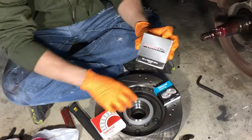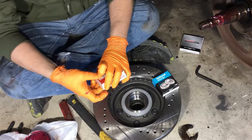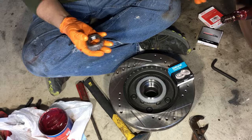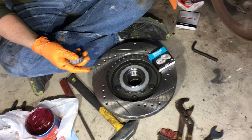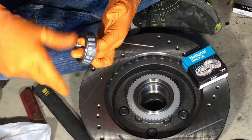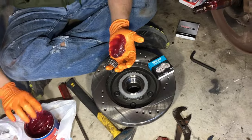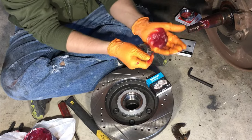I've also got a seal which will go on the outside. Take the bearings out of the box — there should be a little plastic cover on them. These are called the races. My wheel already has them in there so I don't need that part of the bearing. Grab a big ol' slap of grease. A lot of times you'd do it with bearing packers, but I'm old school so I'll do it in my hand.